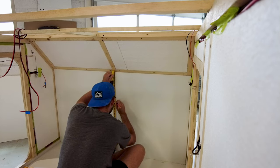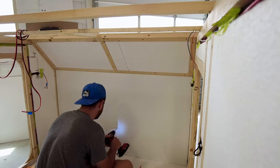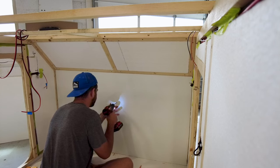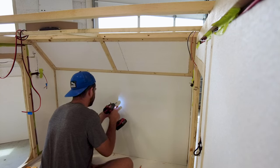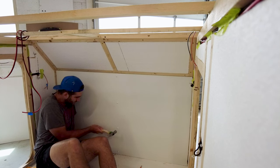I'll be using white 1/4-inch nylon rivets to permanently hold the panels into place, so I mark out where I want each rivet to go and drill the 1/4-inch hole for each one. Once the holes are drilled, you simply insert the rivet and lightly hammer the center shaft to lock the rivet into place.